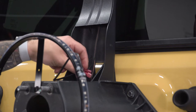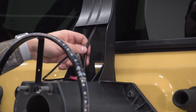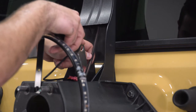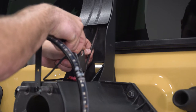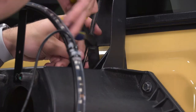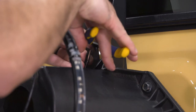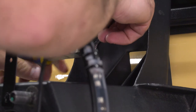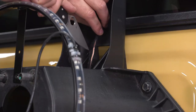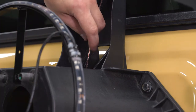How you want to route the wiring is up to you. You can tuck it down a little farther, or pull the plastic cover off and go a little higher. I'm going to go straight back right into this wire loom here. Either way, you'll need to grab a knife to cut the netting aside so we can access the two wires — the ground and the positive — underneath. Make a small incision in that net without damaging the wire, then switch over to wire cutters to snip away some of that netting and get better access to the wires underneath. Now we have easy access to the ground and power to tap into.